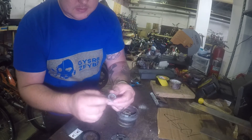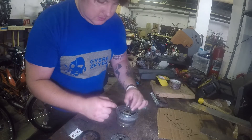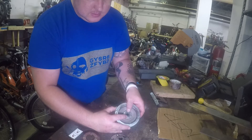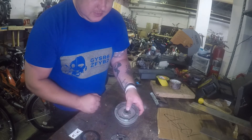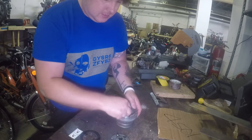This little double washer — here, the gap — if you look at it one way, there's no indentation. You look at it this way, there's a little indentation. It goes just like that, it sits right on top. If you flip this and put it back together, it'll lock the entire variator up.